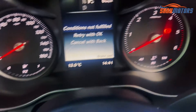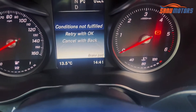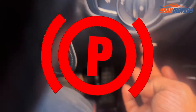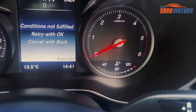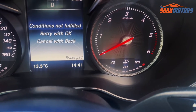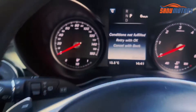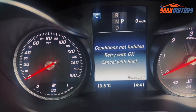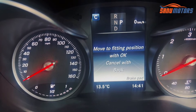Before that — I can't press OK because I still have my parking brake activated. That's why it's not going to work. I have to release the parking brake first. See, now the parking brake is released. Then after that you press OK and it will work. That's the mistake I made.